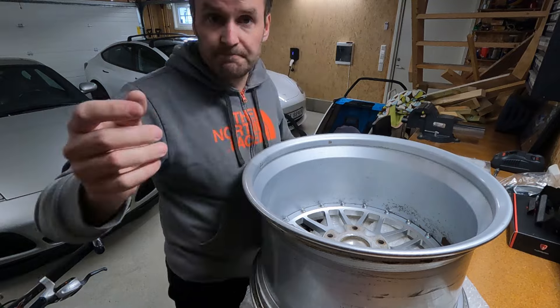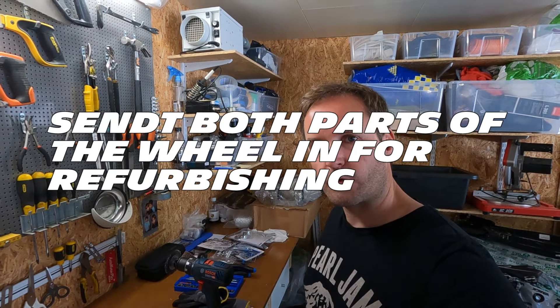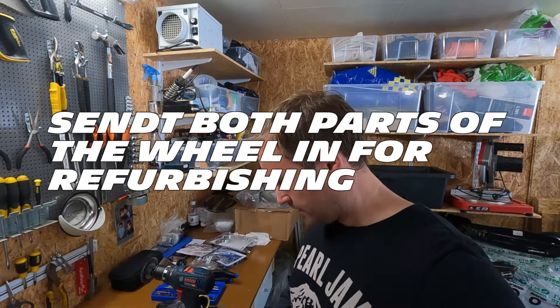I split them apart and sent them both in. Now I'm cleaning off the Loctite and about to put the wheels back together. The best way I found to get them clean was to leave them in a glass jar with carb cleaner for maybe three, four, or five days. The rear bolts, which had less Loctite on them, are pretty much completely clean, but the front ones still need some work — even after leaving them for over a week, they had a ton of Loctite on.